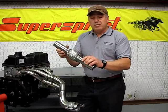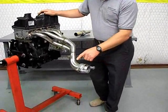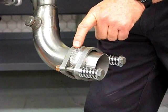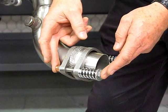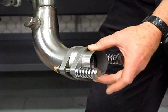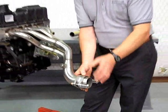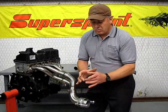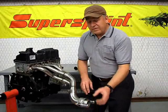That system is fairly inexpensive to put in, but not the optimum coupler. What SuperSprint has developed is a ball joint at the base of the header — basically a composite steel mesh type seal that fits in there, along with a bell. We torque the bolts down to a specific tension to allow a little bit of tension on the springs, and that ball joint can move freely. So when the engine torques back and forth, you're basically sliding on that seal — it keeps a good seal and allows the motor to move with very little wear. When something does wear out, you purchase a new seal: a small ring about four inches in diameter on the outside that slips right over the collar, and the ball socket fits right over that point again.